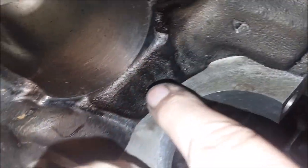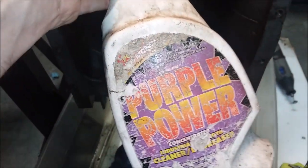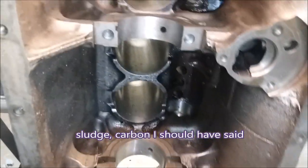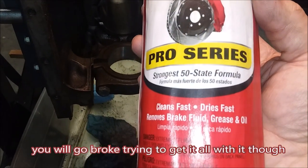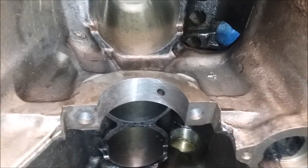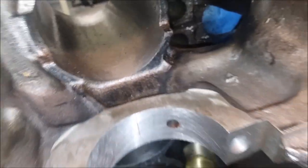I've tried a variety of chemical cleaners — Marvel Mystery Oil, and others. Something that really helps, believe it or not, is Purple Power. Just keep spraying it on and brushing. You can tell with a paper towel whether you're still getting grease off or if it's coming clean. The best chemical cleaner I've found is brake clean pro series, strongest formula — nobody is sponsoring me, I've just tried a lot of things.